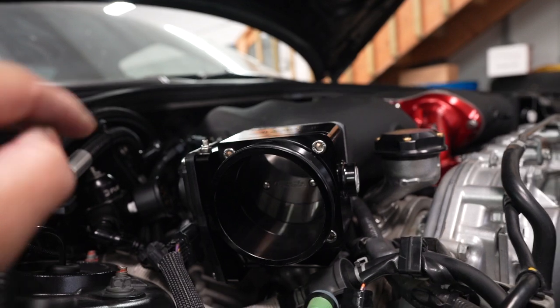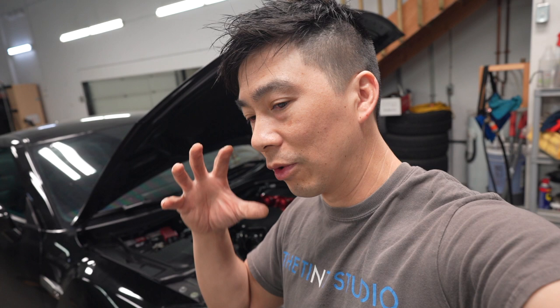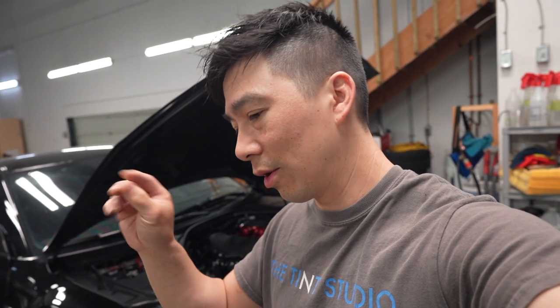But they're kind of a headache. The butterfly flap itself doesn't come assembled. I know they have an instruction video on how to install or swap all the internals from the factory to the larger throttle body, but the only thing they didn't say is the butterfly flap is already installed in the video — when they send it to you, it's not. And the only problem was they didn't tell you which side of the shaft the butterfly flap sits in, and you have to have it the right direction because it won't close or it will just stay open. And I found out the hard way.